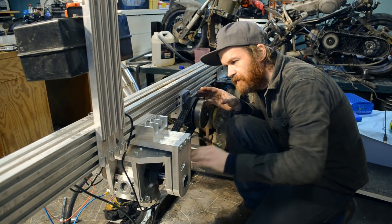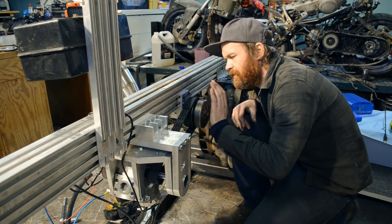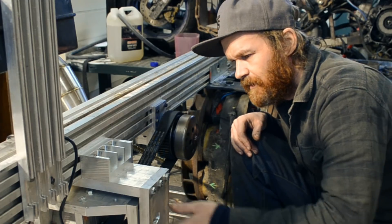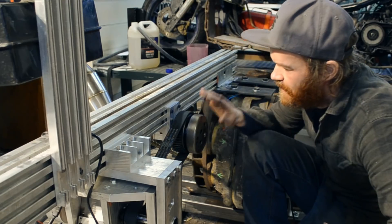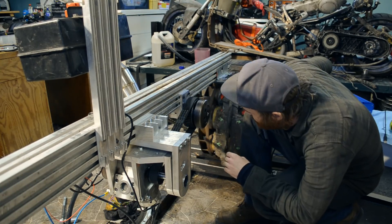Nothing fell apart. The engine is running fine, everything spins freely. We need much stiffer clutch springs though — it's grabbing almost at idle, and there's no power down there with this engine. In fact, there's probably not much power at all until maybe 14,000–15,000 RPM. So we can't have the clutch grabbing at three, four, or five thousand. Need to get some clutch springs — I might have some.